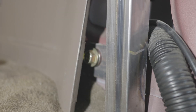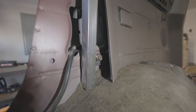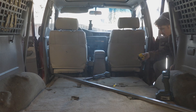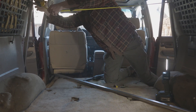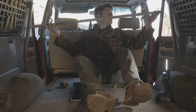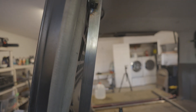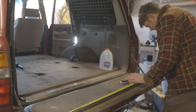The very first thing I want to do is establish these crossbars made out of one inch tubing to build a base from. The bolts are going right into the seat belt harness mounts, so I figure this is going to be strong enough for the whole apparatus. After welding some steel plate to the tubing and drilling holes for the seat bolts to go through, I measured and cut the bridge piece which will tie the whole thing together. This gives the structure enough rigidity to hold all the extra weight on the three-quarter inch plywood. I'm trying to stay true to the interior body lines, so I have to cut this piece with a little angle on each end.